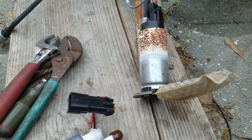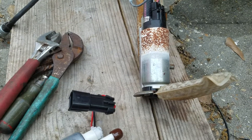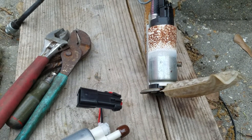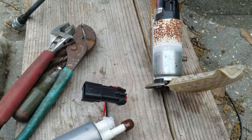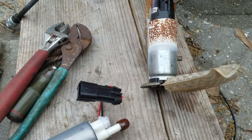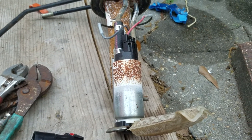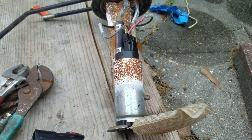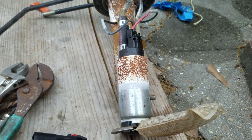This is a short video on the Walbro fuel pumps that everybody talks about. I seem to have a problem with low fuel pressure and I'm not sure why — I can't get more than 40 psi out of this supposedly Walbro 255 liter per hour. I've heard a lot about how there are counterfeits out there.